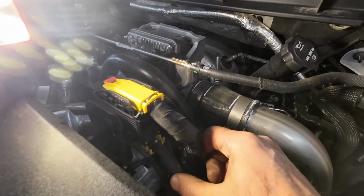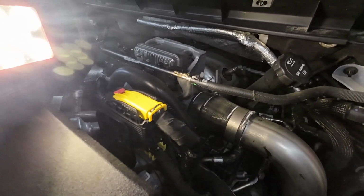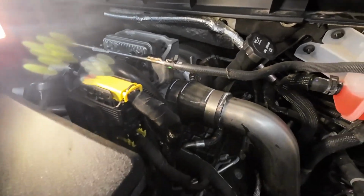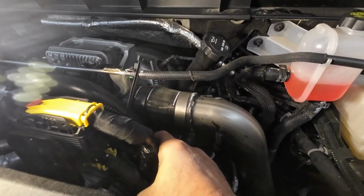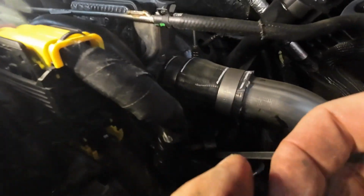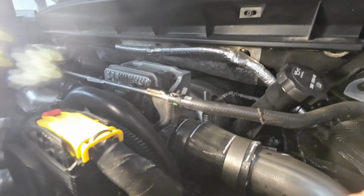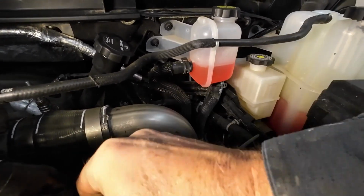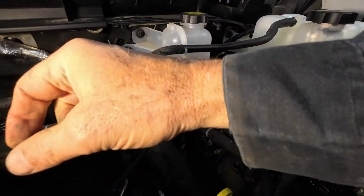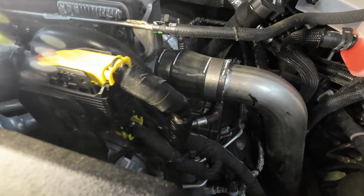Are you going to get 1,000,000 miles out of this? This truck won't do it, but if you're working on a semi-tractor and put 1,000,000 miles on there, there's a good chance you're going to have broken wires in there. So this is a simple case where you put one little zip tie like this in the appropriate place. Now when you're putting zip ties on, make sure you don't put them on too tight, because you could be causing more harm than good if you don't use these zip ties correctly. So we just put this zip tie on here snug. Now you've just turned this all into one. There's still flex and movement on here, but there's not as much. So as far as I'm concerned, that was considered a hot spot, and I took care of that one with a zip tie.